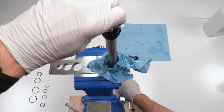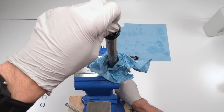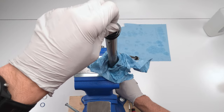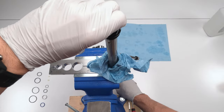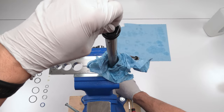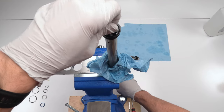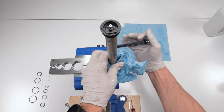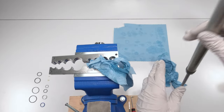Right now we're probably in the lock position. There we go. Now we're unlocked. And it's going up and down. Yep, all nice and quiet. Not a peep. Awesome. This is the lock position. It does not move 1 millimeter. Literally, not 1 millimeter. We are good. Our damper is bled. And complete.